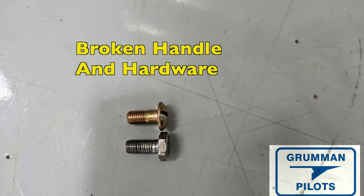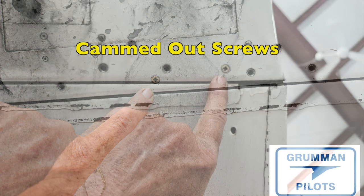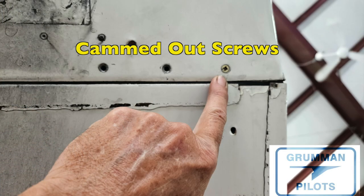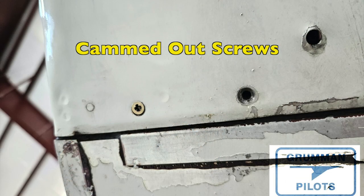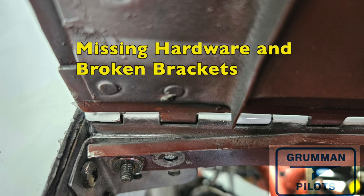Here you can see a comparison of the two bolt heads — the AN4 and the clevis 24-8 bolt — and how they each affect the profile along the shaft. Get the right one for your airplane. Cammed-out screws are a fun one: screws are about 27 cents each in stainless steel. It's not worthwhile putting an old cammed-out one back in, because you'll have to either ream it out or easy-out it. What you save in 27 cents you probably spend 20-plus dollars in labor to get it out.